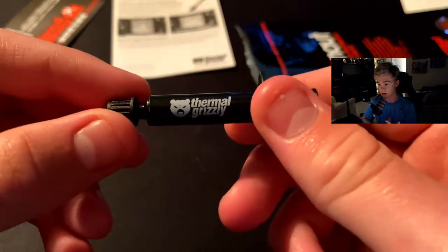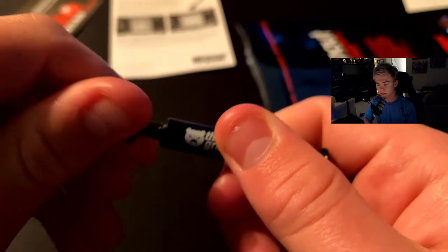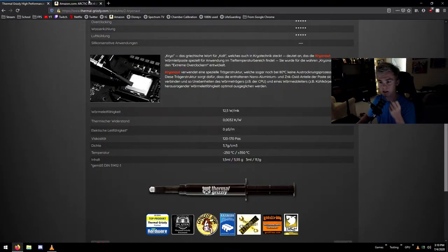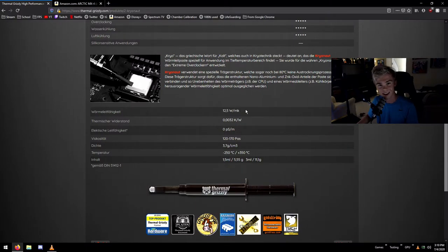That's a very small container — that's a very nice little thing from Thermal Grizzly. I actually got this instead of the Conductonaut, which is the liquid metal, just because that can be a lot more difficult to work with especially for the first time. Now I'm going to compare this to something like Arctic MX-4. MX-4 is about your standard thermal paste, something you might get in the box with like a Ryzen cooler or something. It's rated at 8.5 watts per meter kelvin.